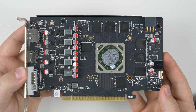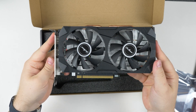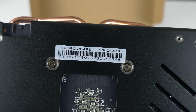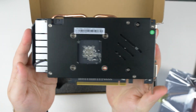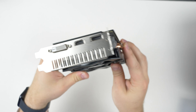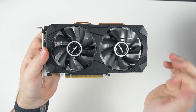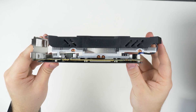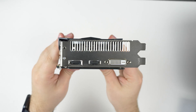So it's legit — this is GDDR5 memory, 16 gigs. For just around $15 you can get 16 gigabytes of GDDR5 memory for a graphics card. If you're able to add or swap VRAM on a 580 — previously all single 1-gigabyte modules totaling 8 gigs — you have an easy way of getting 16 gigs. But as mentioned, it doesn't make a whole lot of sense because you'll be so bottlenecked by the GPU itself that the VRAM won't really improve your gaming experience much, though it will be used in some unoptimized games that just eat up VRAM.